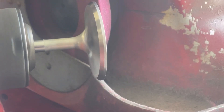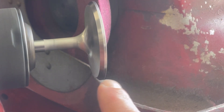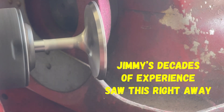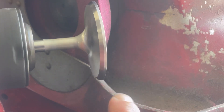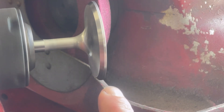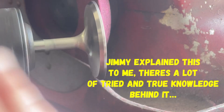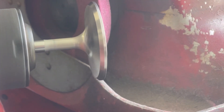If you look here in this video, you can see on that valve on that seat — look how it's going back and forth. What Jimmy is doing is taking it on this stone slowly but surely, cleaning that up so it's actually true. Instead of going 45 degrees, it's actually going to go 44 and a half degrees. That way when it's going in and out of the valve seat, it's actually sitting there and making a good tight seal.